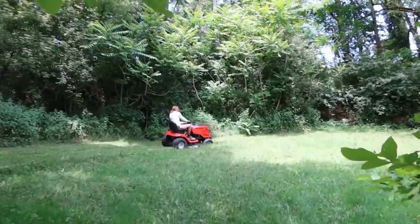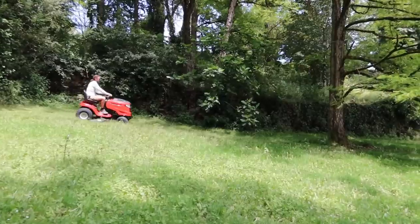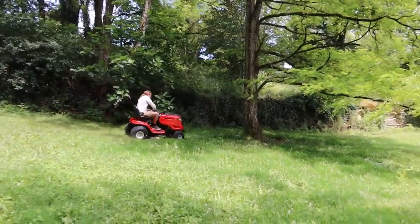So we're talking about the tractor mower — it's a mower, yes. We'll stick up some funny footage of me sort of out of control trying to drive this thing. We got my dad over; he used to be a lawnmower repair man. He discovered the tires were pumped up way beyond what they were supposed to be, so they were deflated. He also was adjusting the settings, and we think we have something that now works, even though it's still not as designed. We think we can nurse it through — let's go see if we can make it work as a demo.